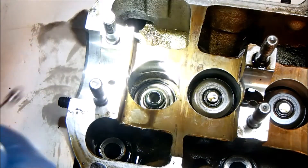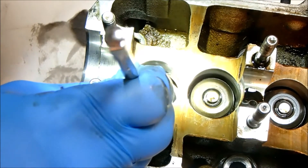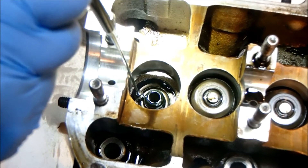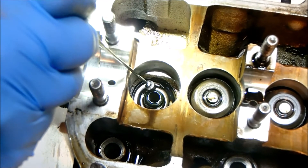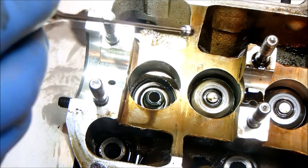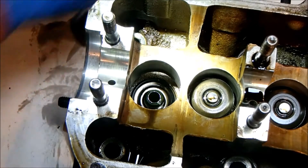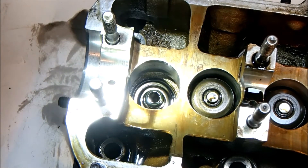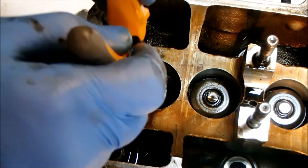In the bottom here there is a thrust plate — I'm sure they've got a name — which takes the spring and stops it wearing into the aluminium, I'm assuming. It's locked in place by the valve guide oil seal, which is the rubber piece here. So I have to get that out before I can get the spring seat out, and obviously I don't want to scratch anything up. Sometimes they can be a bit of a struggle to get off. Maybe a long needle nose pliers might do it — I just don't want to wreck anything.